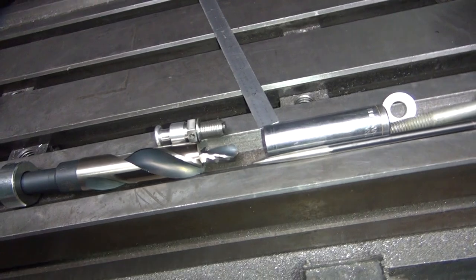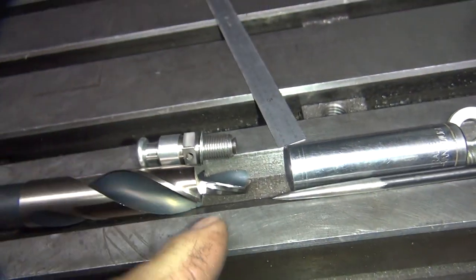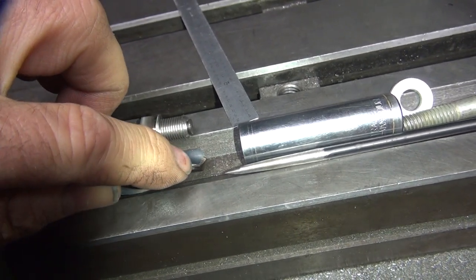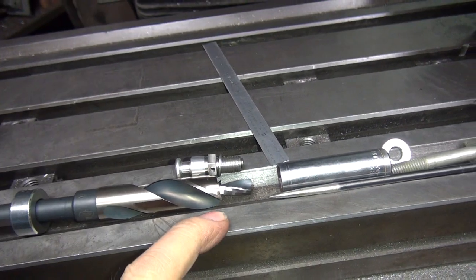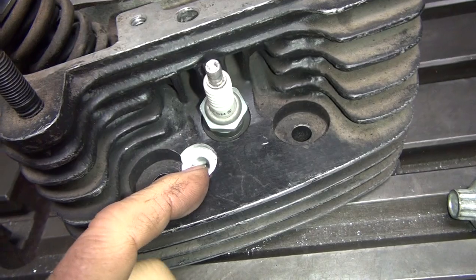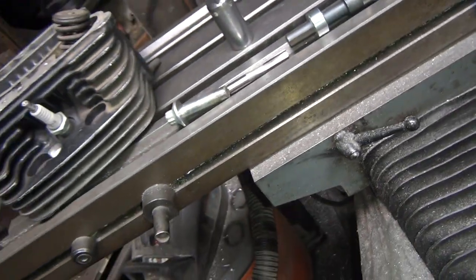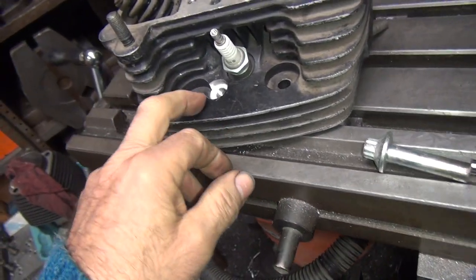Put this about where it's going to be on the edge, line up your depth — you can see how this cutter goes way more than we need. If I shorten the cutter up about 3/16 to 7/32 inch, that will give me that much more material. So I'll have a lot more material — if I can get 175 thou out there, at least 150. If I gain 30 over here, that's 175 I can gain; I already have 30, that puts me at 200. They want 225 minimum, so 200 thou is close enough — if I get 200 thou I'm happy.